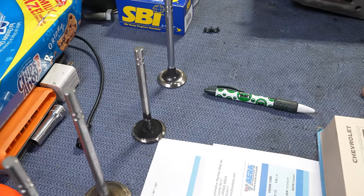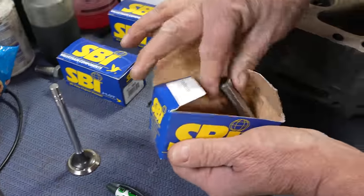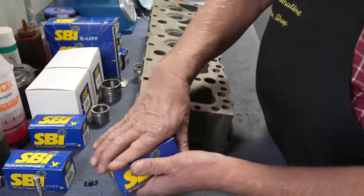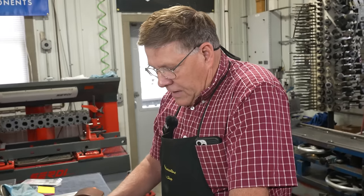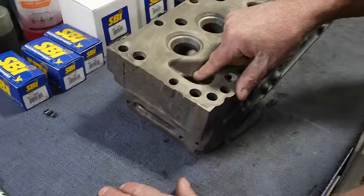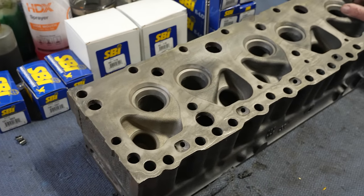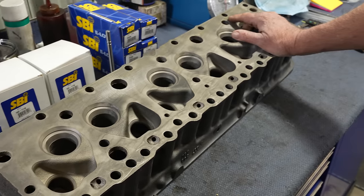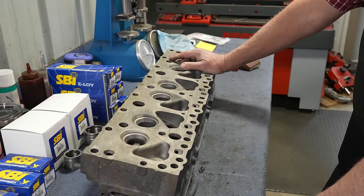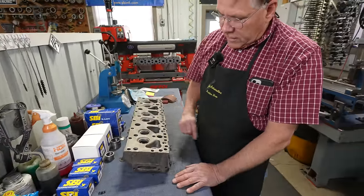We're going to try to do it up as well as we can. They've sent us all new valve guides, so we'll go ahead and put those in and fit them properly. As far as the valve seats go, this should have had hardened exhaust seats put in by now, because this will be run on unleaded gas, which is not what the engine was designed for back in the 50s when it was first built. So we will be installing a hardened exhaust seat, and that will also help bring the valve back up.